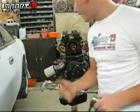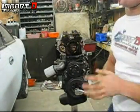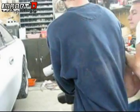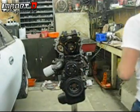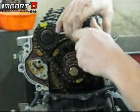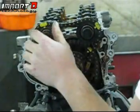As you can see, sometimes you may need a breaker bar — these things are on there incredibly tight. The socket is going to be a 24 millimeter and you're going to need a buddy to do this at a fair minimum. If you're by yourself you can use an impact, but I always recommend against using an impact on internals just in case you strip something out — that's no good for anyone.